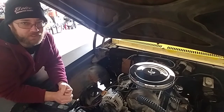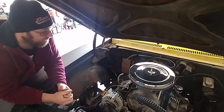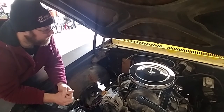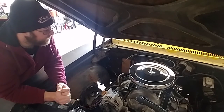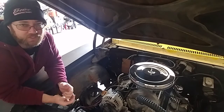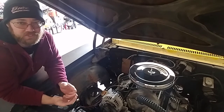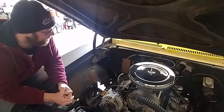I don't know. I'm kind of leaning more towards the front pump is leaking, so that might need to be sealed up again. Gonna have to pull the transmission out for that, which really sucks, but it is what it is. Talked to my buddy that's got a little rat rod car that he built, and he's got a Turbo 350 transmission in his car also, and it's leaking almost the same manner. He's pretty sure his is the front pump, so I don't know. I've read online that it's not a very common issue for the front pump seal to leak, but it happens, so dealing with that.